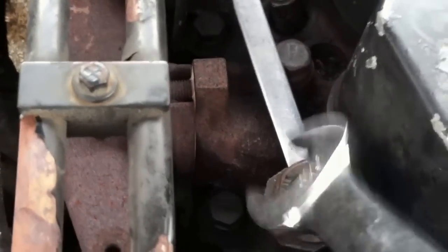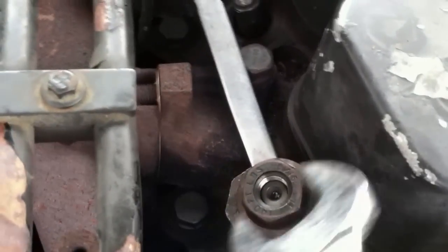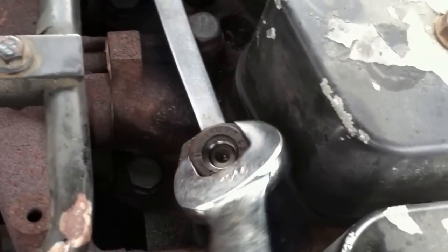without much effort, pulls the injector right out. I let the injectors sit in a little puddle of brake free or whatever, probably about 10-15 minutes while I found the right parts. I don't know how much it helped, but it's going pretty smooth.